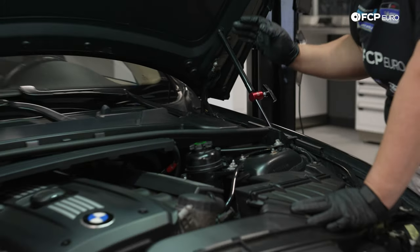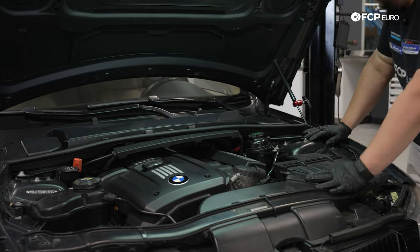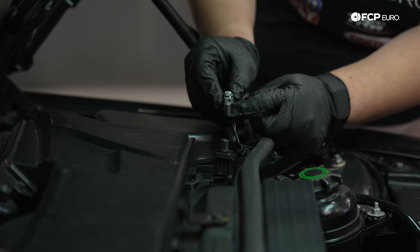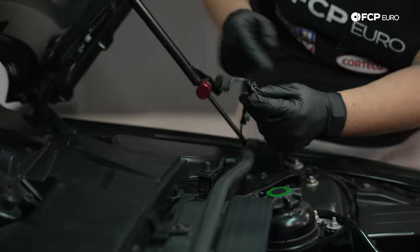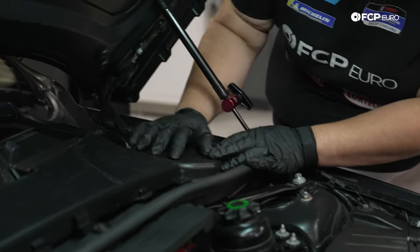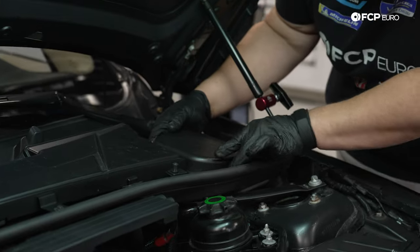So with that, first things first, we'll start by disconnecting our hood sensor here. We're just going to unclip it and remove it out of the way. Just a regular little electrical push tab, some alligator clips, and we can swing it out over here by our air box. On either side of the cowl, we have covers. This one protects, or covers, the master cylinder.